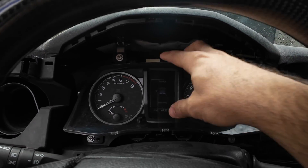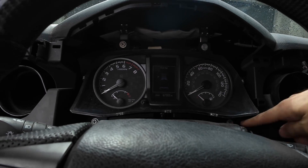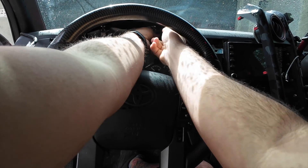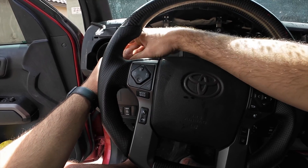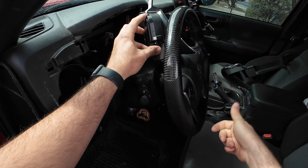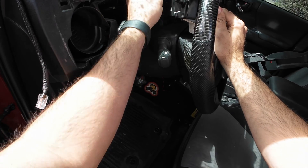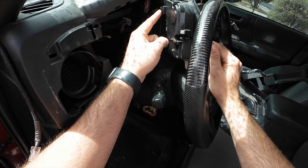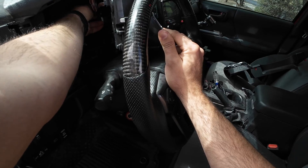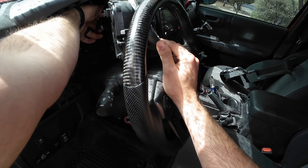The next thing we need to do to actually pull this out — there are four screws we need to take out, two in the top and then one down in each bottom corner. There are little silver screws down there. This is going to be a tight space to work with. What I did was pull my steering wheel all the way out and down just to give me a little bit more room to work with. There are two wires plugged into the back of here. The one further on the right side, which would be the passenger side, that's the one you're going to want to remove to install our plug-and-play harness.